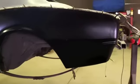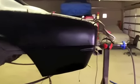Here's another small update on the Camaro. I have the quarter skin mocked up. I just need to do a little more grinding and it should be ready to weld on. I'm going to seam this one close to the door jamb, the way I kind of like to do it — it's a lot easier to do it that way than it is in the jam, and it all looks pretty good.